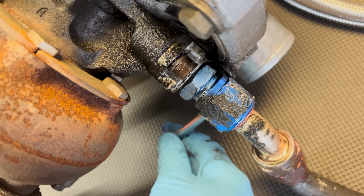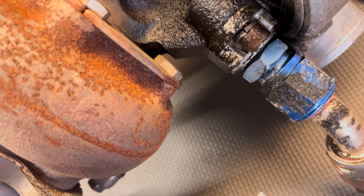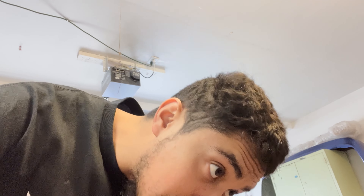I'm almost positive the leak is coming from this gasket right here. Unlike most Hondas that burn oil because of piston rings or valve stem seals, this one doesn't actually burn oil. But I do have times where the oil level drops, and that could very much be because of this return line leak from the turbo and also the valve cover problem with that bowl. I've driven this car hard plenty of times where other cars would have already burned oil, but this single cam civic — piston rings seem good and the valve stem seals also seem good. The EM1 I do have a problem with the valve stem seals, so I'll be changing those this year.